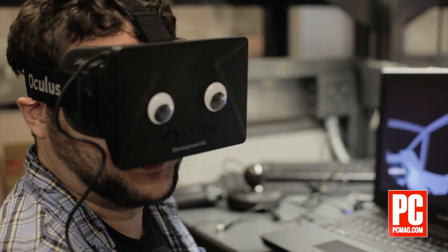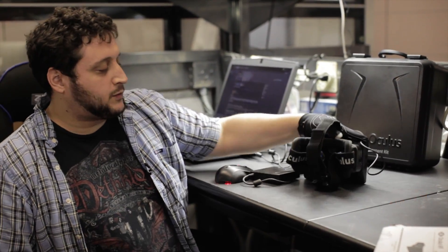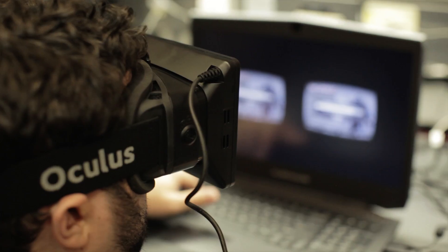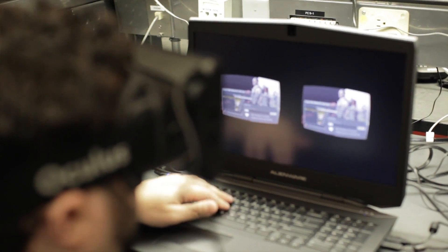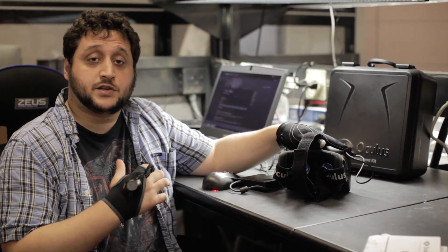My name is The Plague. 3D works by showing a slightly separate picture for each eye. The way the Oculus Rift works is, behind these lenses is a single LCD screen, which the lenses themselves split up into two equal halves. Everything is done by whatever software is running, which means you don't have to deal with any weird display adapters or special hardware, and the Rift itself does not need two LCD screens.